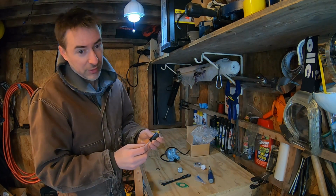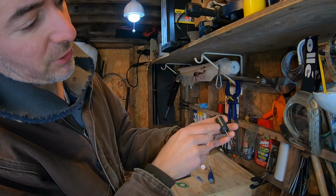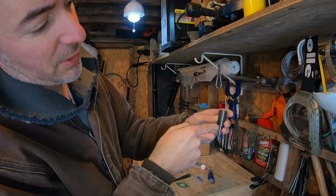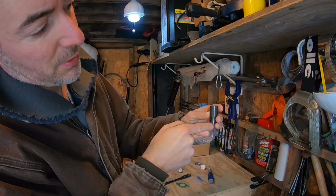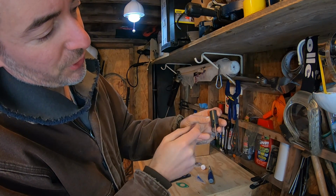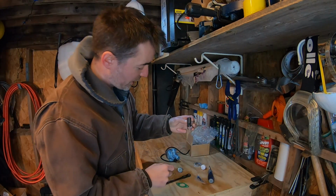Another thing I'll call out, this throttle body. Nice and smooth in here, and this is where the idle adjust spins in or out to adjust how far down the throttle body sits for your idle. The original one there that's 30 years old, it's got a big dimple in there, so it can get kind of hung up when you're trying to adjust your idle RPM.